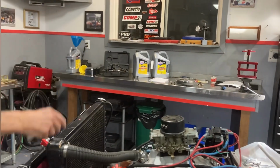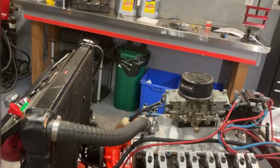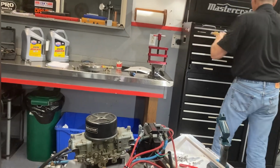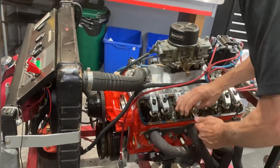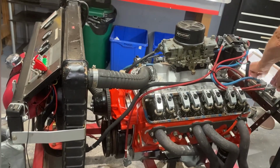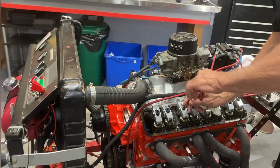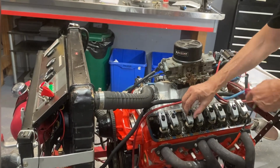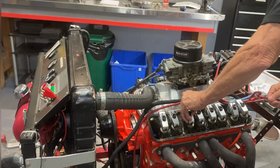So I'm going to adjust one valve and show you how easy it is. So let's back this one guy off. Oh, it's not a 5/8. I've got 2 different sizes of wrench. It won't take long to fix that. Number 3. Back this guy off. So this is the intake for number 3 cylinder. And I'm backed right off. You see I've got lots of clearance there.